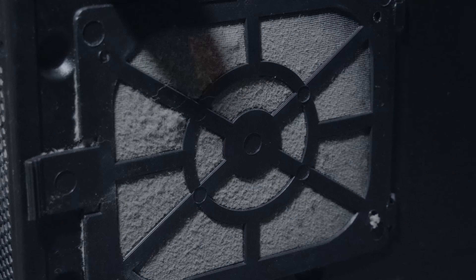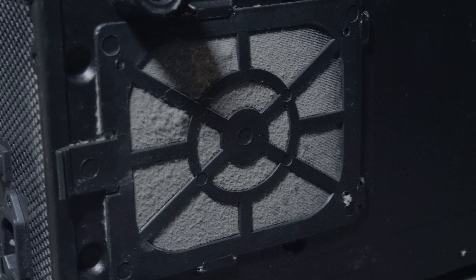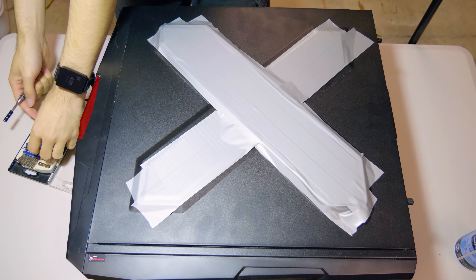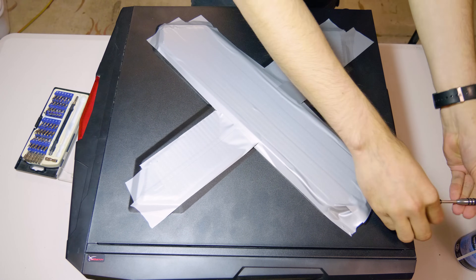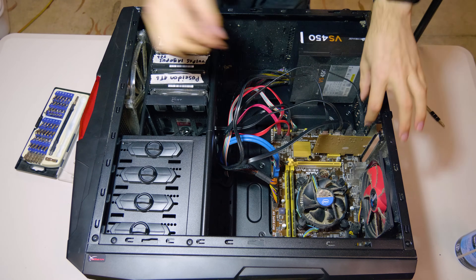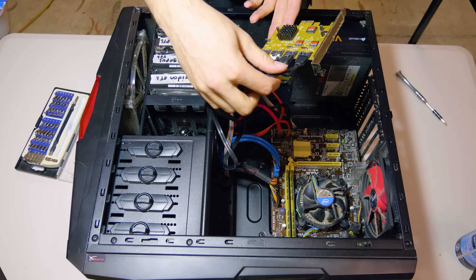Once the side panels are off, if you have video cards in your system you can take them out now. Hard drives in a caddy can also be removed if you want, but drives can usually stay in. We're ready to start blowing out the dust. I recommend leaving the CPU cooler on the CPU during your first initial blow because you don't want dust getting into the socket and possibly shorting out your CPU. Whilst this is extremely unlikely, it's better to leave the CPU cooler on for now and take it off a little bit later. So first, let's blow out all the dust.